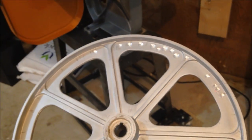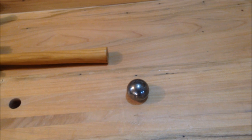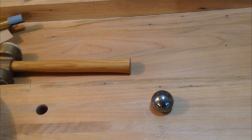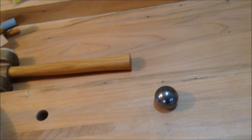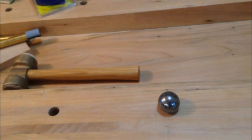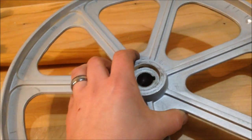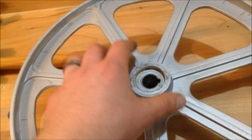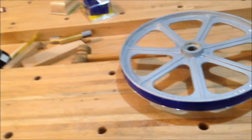Since we can't really spin it, here's a trick I learned from an old fellow — and today 'old' is anyone over the age of 32. Grab yourself a ball bearing; if you're in a pinch you could use the end of a smooth screwdriver. You don't want to use something tapered — you want something that'll allow it to roll. If you can get a hold of a large ball bearing about the size of a golf ball, you are in business. We're going to place this wheel right on top of it.